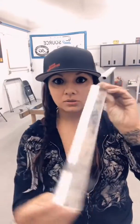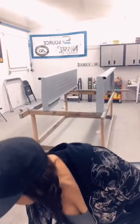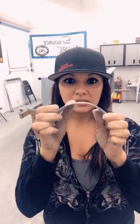Another option, just so you can see. It's just plastic, simple and easy. They come in different thicknesses. These I love because you can go like that. And it sands nice, especially with the fenders that we're doing right now, with a nice curve on there. You just put this like that. Sands nice and straight, easy peasy, really quick. If you use the Dura blocks, you can't do that, so it's a lot of different angles you have to do to get that straight.